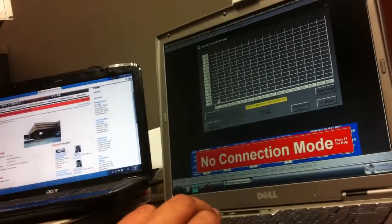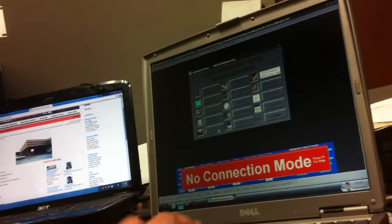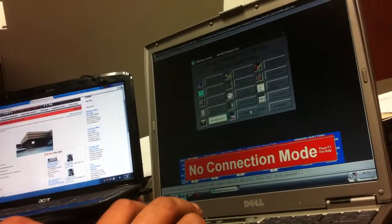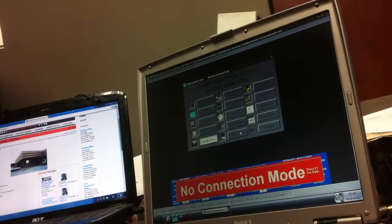Yeah, that's pretty filled out, eh? Yeah, we did a good job. We went pretty in depth with this when we did it. So when you go now up to 7,000 RPM, are there any areas that aren't covered? It'll be fine. If anything, it'll just get a little over-rich. Oh, okay. Well, just watch your gauge. Make sure it doesn't go lean. You should have no issues. You're not going to go up there much anyways.